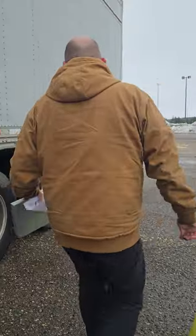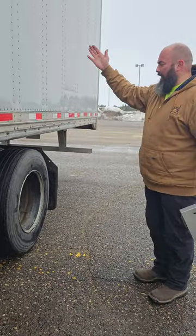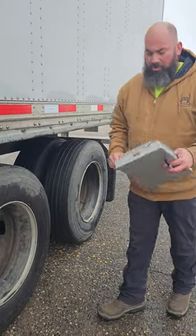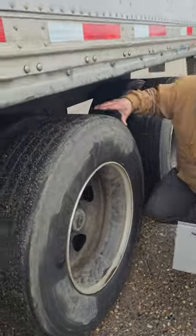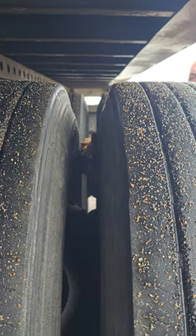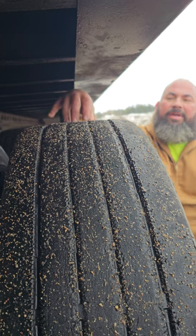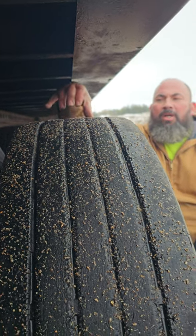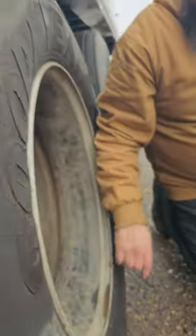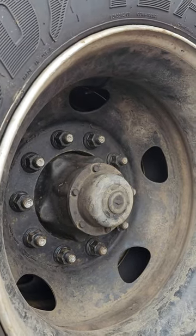Wheels and tires. What I do to this side, I will do to that side. What I do to this axle, I will do to this axle. And what I do to this tire, I will do to all tires. On the inside, it's properly mounted, properly secured to my tire or my rim. And there's no cuts or no bulges. Across the top, it's evenly worn. And there should be no less than 2/32 tread depth on this tire, and at least 100 PSI. And I would check it and add air right here with my metal valve stem with my metal cap.